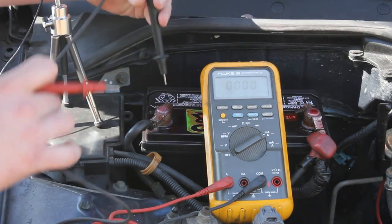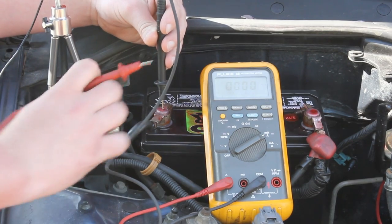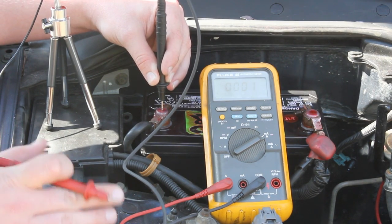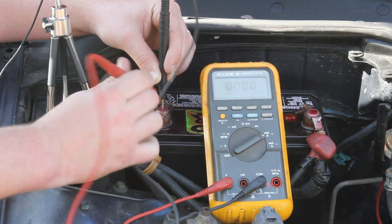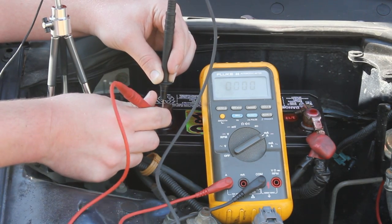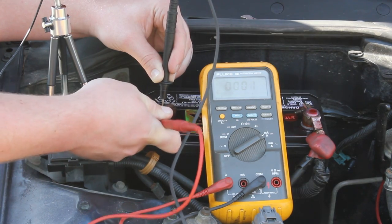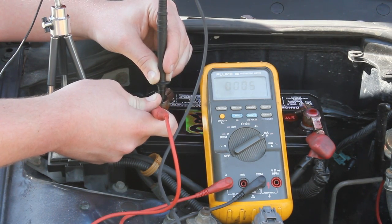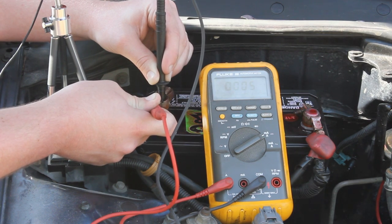What I'm going to do here is measure the current going from this terminal to this cable right here, and my car is in the off position. If you have a steady hand, you can disconnect your battery without having all the negatives like your radio stations being reset. You hold it right like so — I'm holding this terminal to this terminal right here — and I'm going to jiggle it back and forth and disconnect it. And look at that — it's reading 6 milliamps, 5 to 6 milliamps.